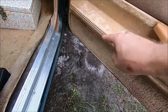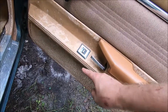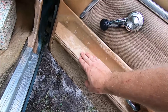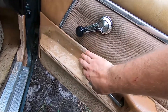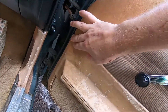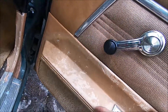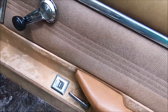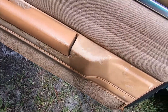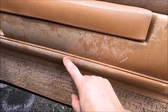As part of the project, when we have them off, we'll probably do something about this deterioration on the plastic. These old GM panels — this is pretty standard, happens a lot. Unfortunately, it's UV light deterioration on the plastic. You can see where it was covered up against the dash, where no light can get in — that's what it's supposed to look like. Over here, with people's hands, fingernails, and just wear and tear, you get this deterioration in the upper level of plastic. You get kind of a thinner, powdery surface where the plastic top coat comes off.